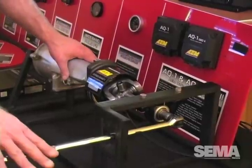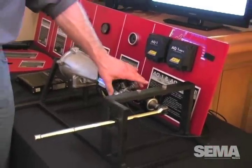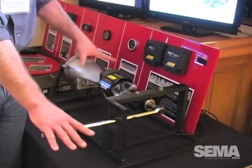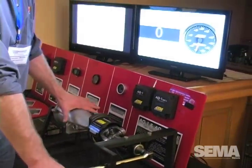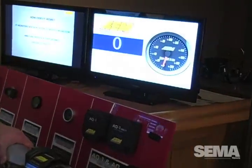In this demonstration, the controller unit attaches to the tail shaft housing. The slip yoke becomes the torque sensor. You can see on this screen right here — if I press down on this breaker bar, it's measuring torque in real time.